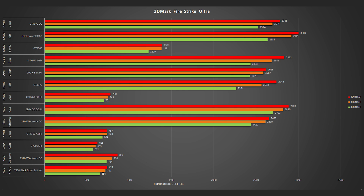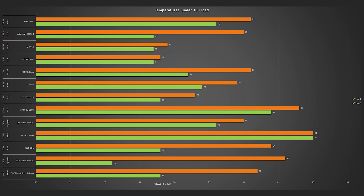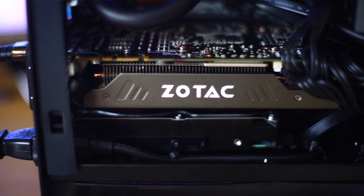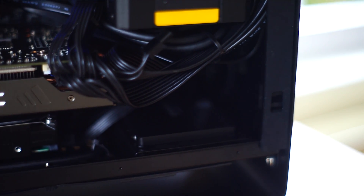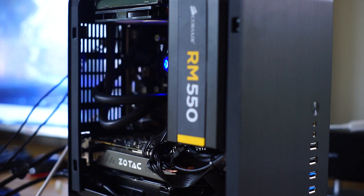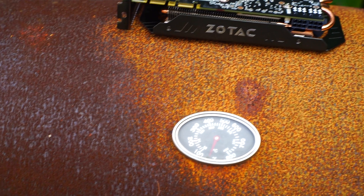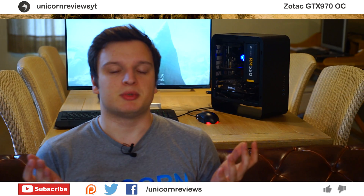You can overclock it a fair bit, but you have to keep the size in mind as it is thermally limited quite badly. In normal usage it runs up to 80 degrees, especially in a compact case, at 60% fan speed which is very bearable — audible, but not loud or annoying in any way. At 100% the fans spin up to 4000rpm and it does get pretty loud, but that's something only done for maximum OC tests and most people will never have these fans run at 100%.